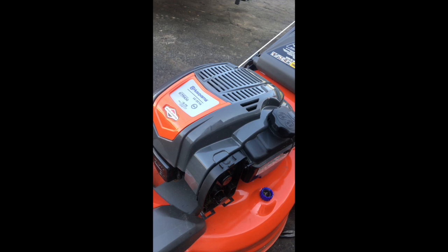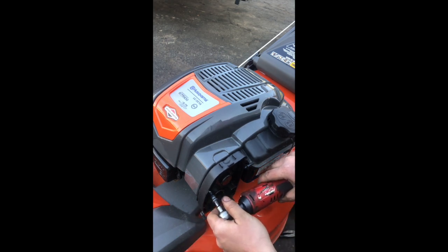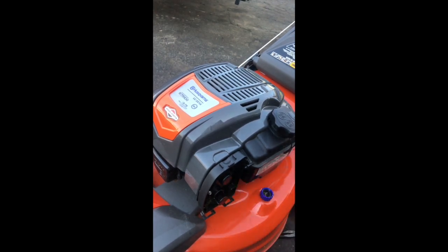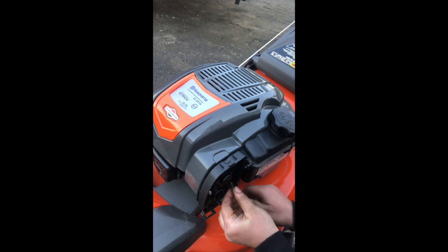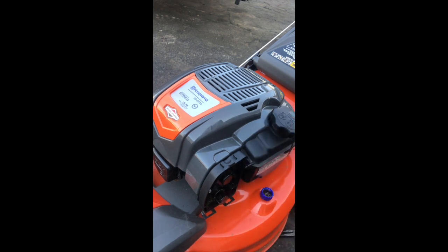Actually, because I have this in my hand, we'll do the smaller one. And we're going to start these by hand. Do not put these on the impact and run them down. If you strip them out, you're in for a bad day. So just start them. Leave it loose. Nope, see, that's wrong. This one. We're in there. That's it, not Gorilla Tight, snug with the ratchet. Switch to our 5/16.